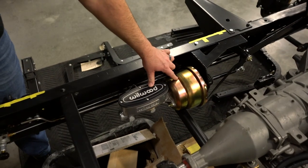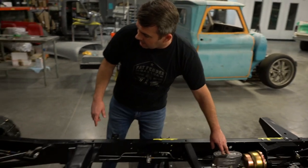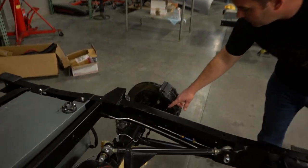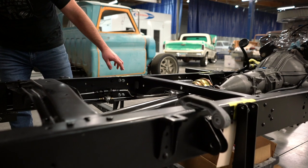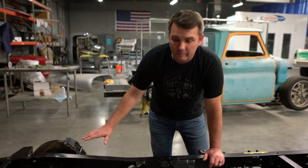We've attached it to a brake booster. The problem with this is that when you're running disc brakes and your truck is lowered, you'll notice that the caliper where the fluid goes in is almost the same elevation as the master cylinder. So what can happen is the fluid can actually travel back in and you can lose some pressure on your pedal.